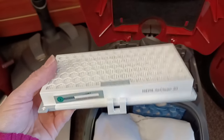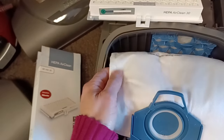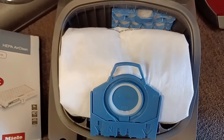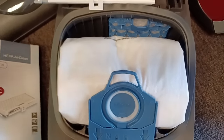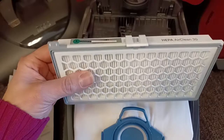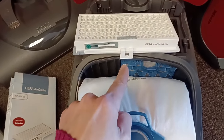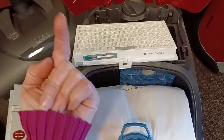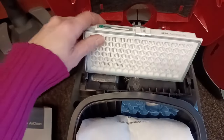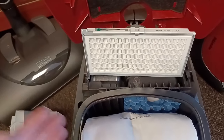It's woven tightly enough — think of it like a mask — it's designed to filter out very fine debris. Your bag does this in a slightly different way, but the bag is a HEPA-type media. This is the real deal. On the underside you'll see that same material; it's all accordioned through. When this is sitting in place, the exhaust air cleaned from the bag goes through the motor, carries a little bit of debris, and the motor carbon is going to come through this cartridge from the underside. So the top side will always stay snowy white, but the underside — if you looked at it after a period of time — will be black.